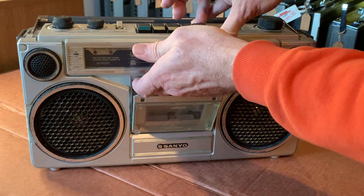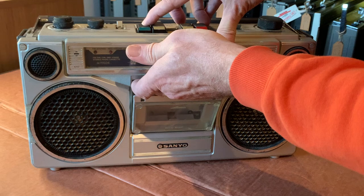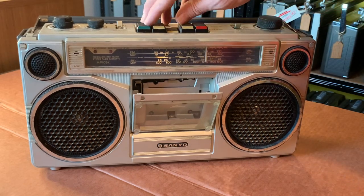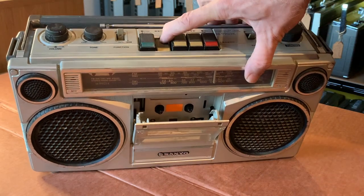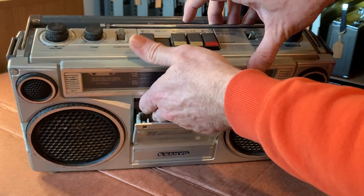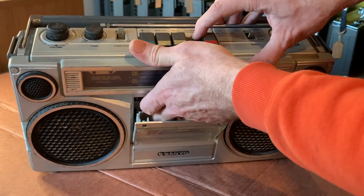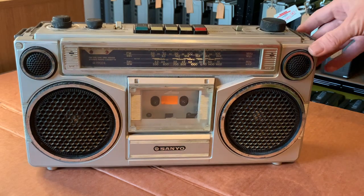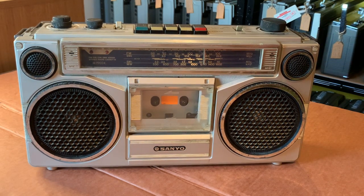Let's have a look at the tape, let's just see if that's working. The capstan is turning quite strongly but none of the take-up reels are working. Let's just have a look at fast forward - yeah, nothing happening there, that feels quite tight. It may be that the spindles are a bit dry or one of the belts isn't on there. The good news is the radio works, but the tape deck needs a service.